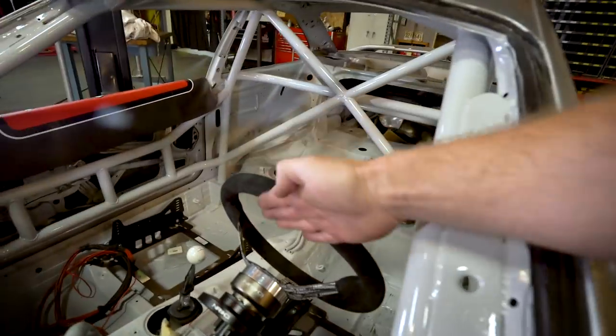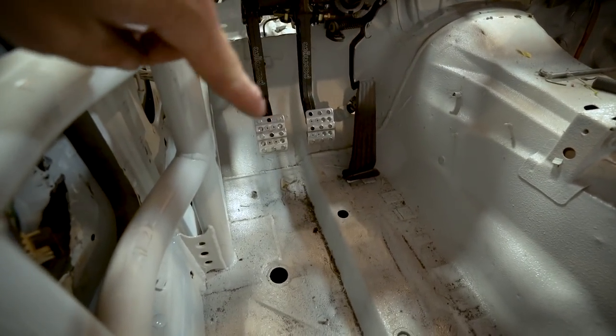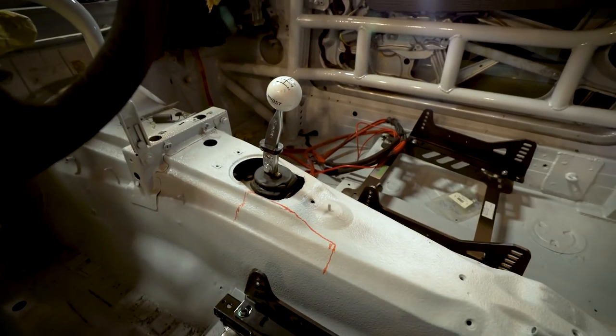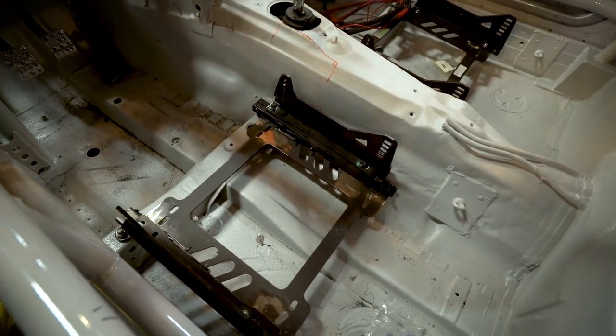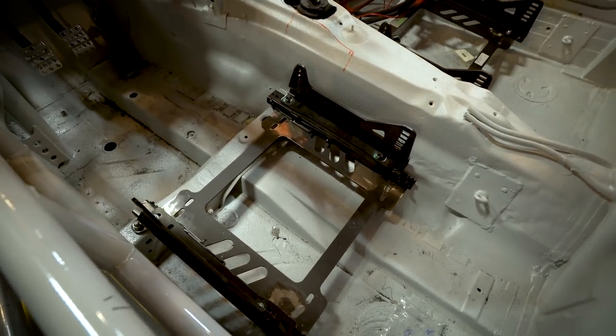The BMW is very flat and this added just a little bit more. I have short arms, so I had to bring it a little bit closer to me. And the other part would be the pedals. The brake pedal was actually sitting a little further over to the clutch, and that would drive me crazy because I like the heel and toe. So I've moved it over just a little bit. And then I added a shorter shifter, and that actually brought it closer to me, back towards the cabin. Now, this seat does not fit me. It's kind of an awkward spot, but I've got it to a position where I can manage, and that's where the handbrake comes in.